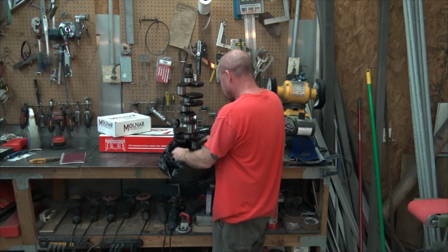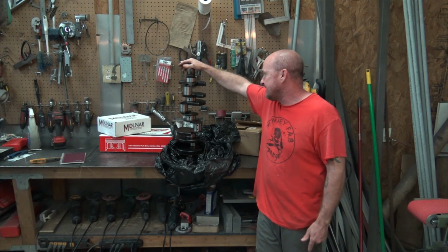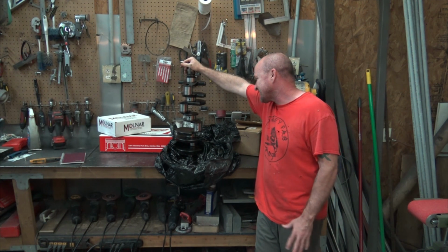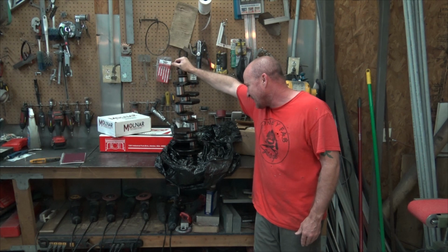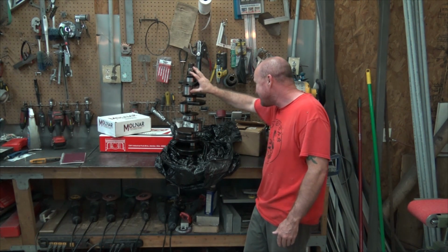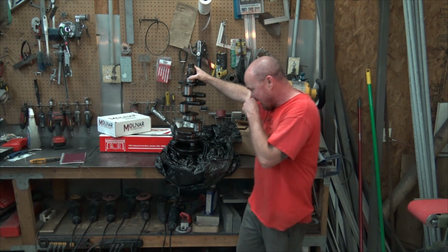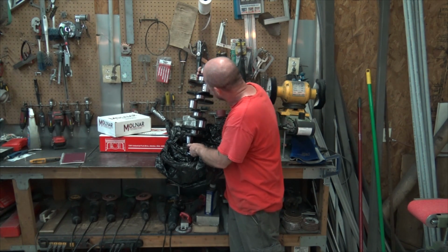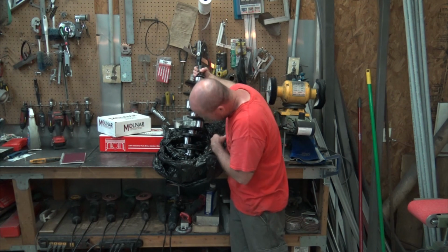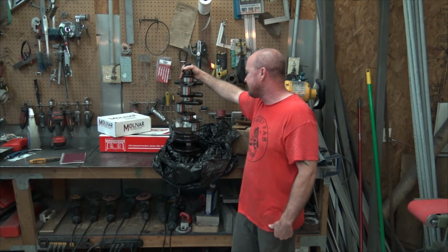Well, the polishing looks a bit suspect. All right, so it looks good. I had a friend polish this for me, actually, a friend who probably had somebody else polish it, and the polishing looks a little funky. But it feels okay, and luckily there is no rust all over these guys, so that's a win. It's already got the 58 tooth. You can see where it was drilled when we balanced it. We drilled it in a couple spots, and here, and here, so it's balanced. The reluctor wheel is welded on, and it's good to go.